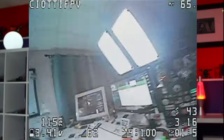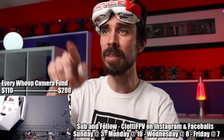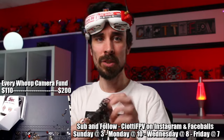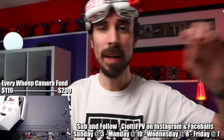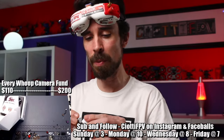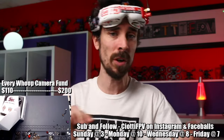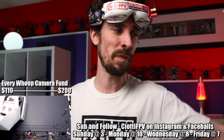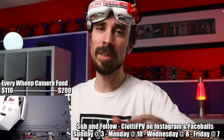Oh, this battery's done. Okay. So, a minute and 54 seconds. That is low because I had this battery plugged in when it was in the ESC configurator, and this is just an older battery. So let's get a fresh battery on here, and we can actually take a look at the runtime. This battery probably only has 4 or 5 cycles on it, and it's at 4.35 volts, so this is a fully charged, non-abused battery. If I had to guess, the battery that I just flew probably has 60 or 70 cycles on it.